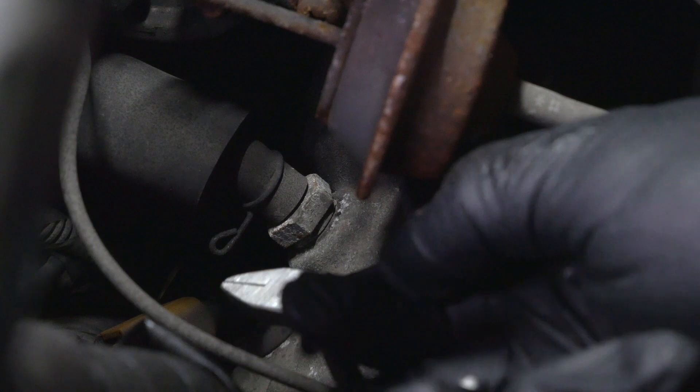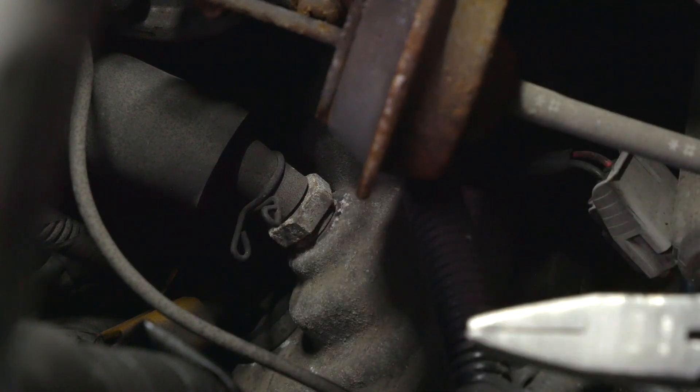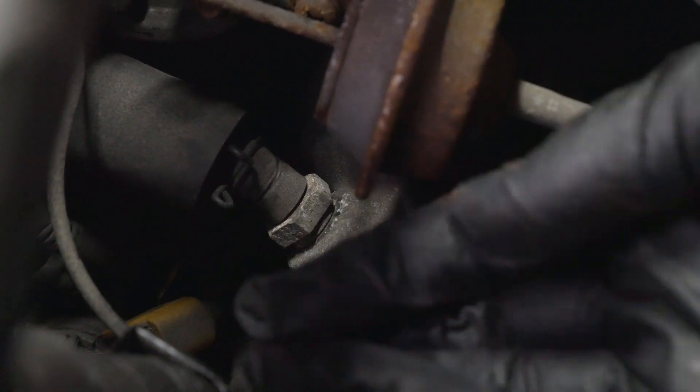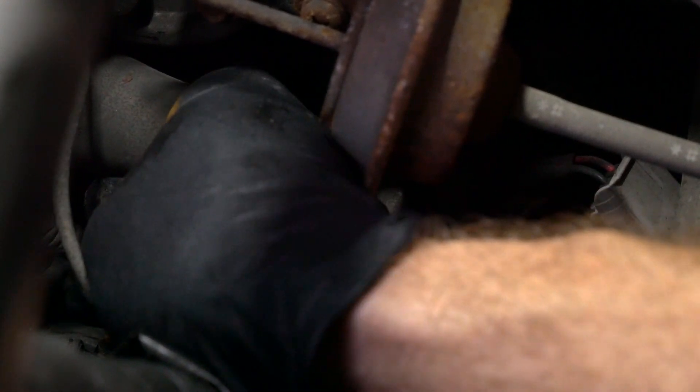What we're going to do now is take off the tube that connects to the PCV valve. I'm going to pull this clip towards me and then get these pliers. Let's try to do it with bare hands — yeah, that comes off pretty clean, pretty easy. I'm just going to pinch that together. Looks like it should be off the valve now, and then just wiggle that off. Alright, we got the tubing off. Let's push that down a little bit just to get it out of the way.